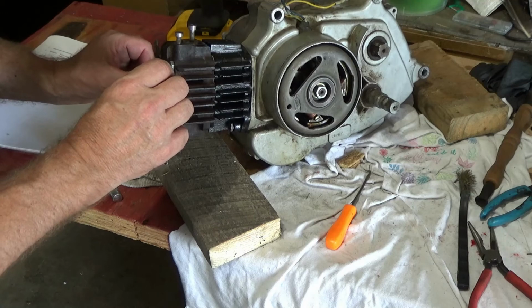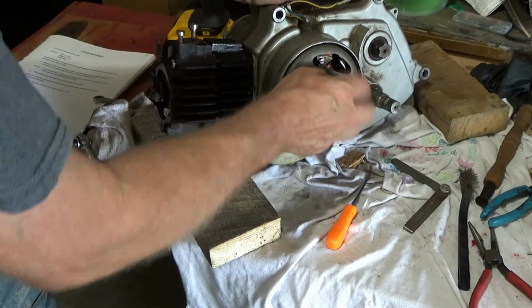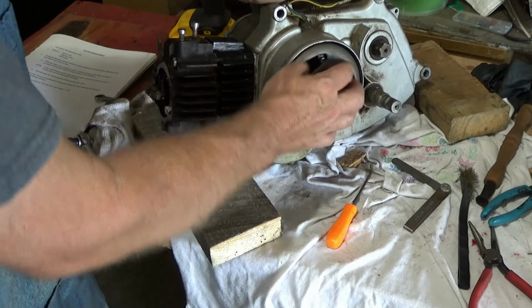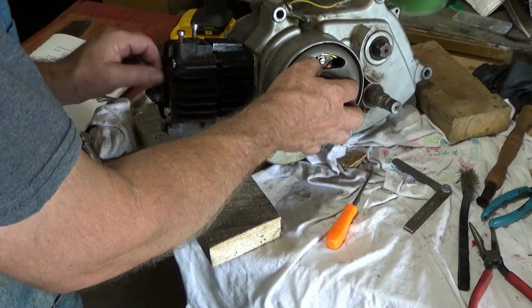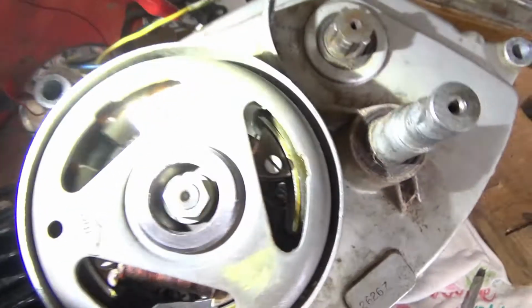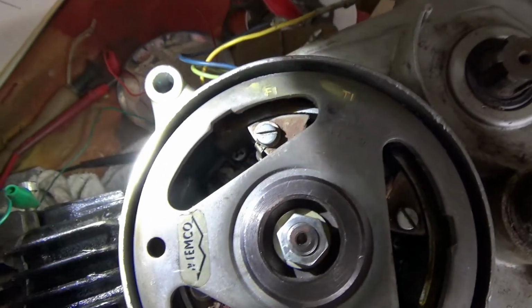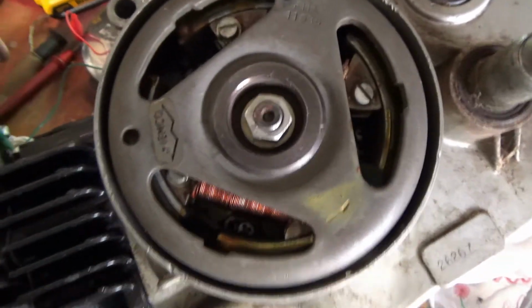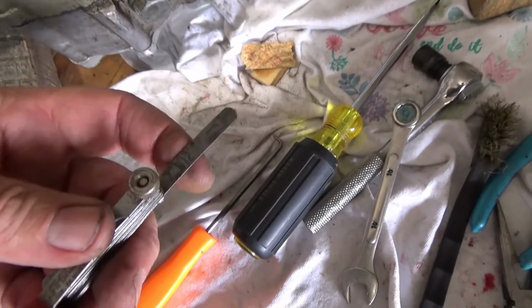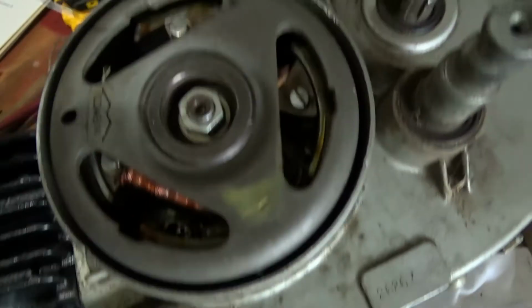That's the exhaust. Okay. Exhaust open. Intake open. And set. There's where the points are at. And according to the book, 12 to 16 thousandths. And you need a relatively small feeler gauge, which, where's mine? There it is. I got one right here. And it's at 12 thousandths. It's at a very tight 12 thousandths. You need a pretty small feeler gauge to get in here.